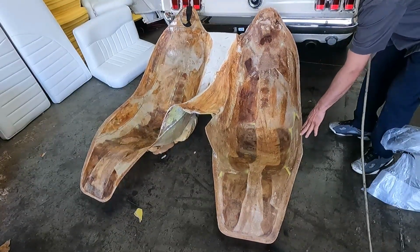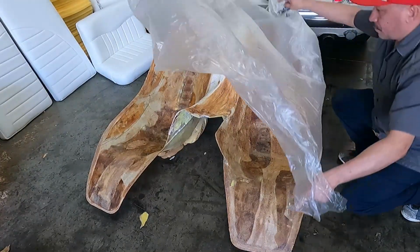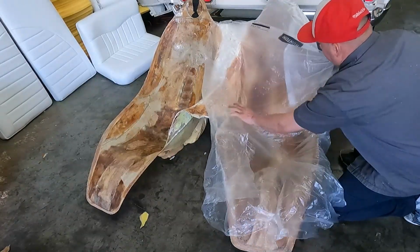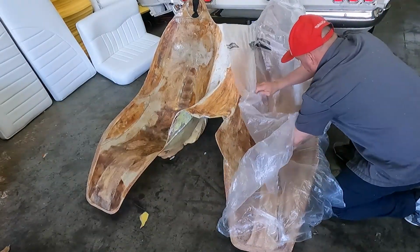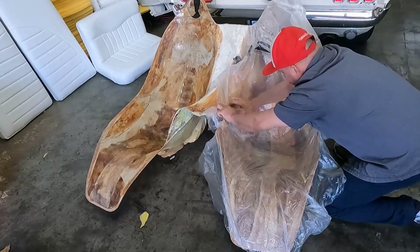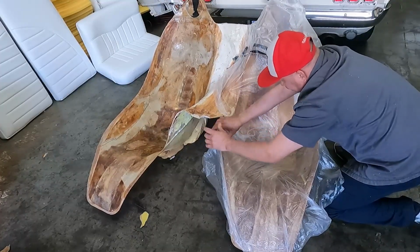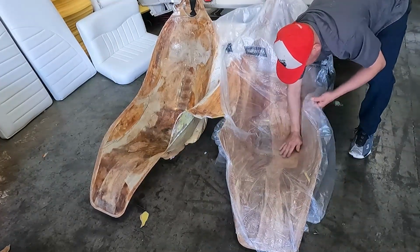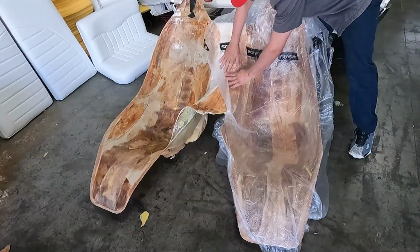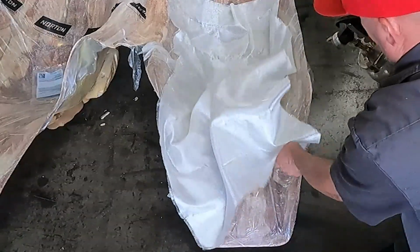And you might be asking, why are you going to put plastic? Well, my friend, because on top of the plastic, I will put 5 layers of fiberglass. 5 layers. Why so many? Because I want the fiberglass to be 1/4 of an inch thick. If I want 1/2 inch thickness, I have to put at least 10 layers of fiberglass, then put liquid to make it dry.